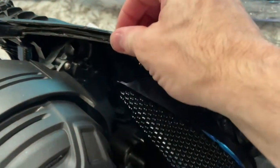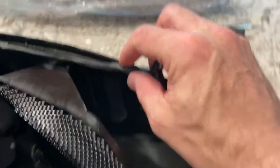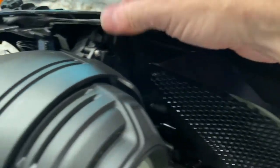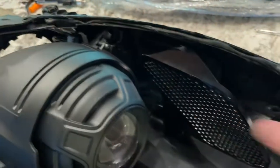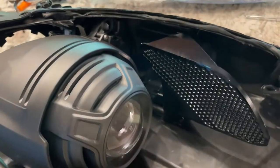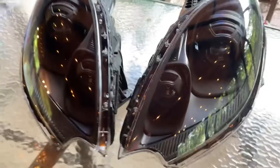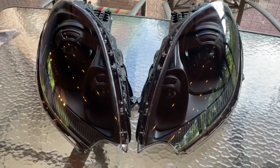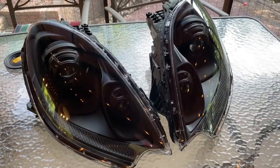For putting in the butyl, I'm taking a thin rope of butyl, stretching it along, and just tucking it in the channel. This is just the first application — I'm going to get it in the channel and then heat it up in the oven again. When I install the lens I'll have this butyl rope around the whole channel, and then I'm going to go around it again and reseal it on the outside. Here the two headlights are ready to go back on the car — both all sealed up, lens replaced, they look good.